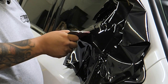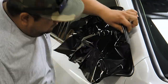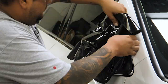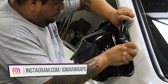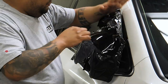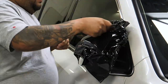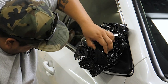Added the alcohol so I could glide smoother on the vinyl. This particular vinyl is meant to stretch — it'll stretch 130 percent of the original film size without compromising the quality or performance of the vinyl. If you over-stretch it, it has memory and it's going to want to return. You know when you've stretched it too far when it starts whiting out, because it's separating the color from the film. When you feel the adhesive side and it just doesn't stick anymore, you've over done it.